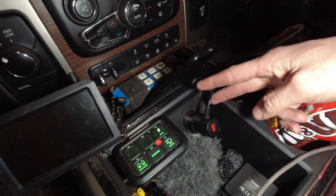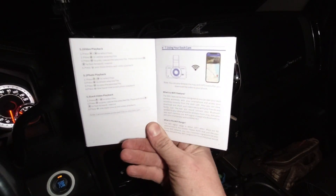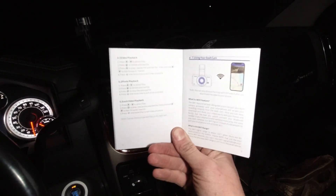What I'm going to do is get another power port and wire it up down under the dash so it's tucked away and you never even know anything is there. I just cheated and ran it to the existing port for now because it was getting close to dinner time and I wanted to make sure I had dinner with the family. If you're thinking just cut the wire and run it positive and negative — I tried that before with another dash cam and turns out that plug is a voltage converter that steps down the voltage to whatever the camera runs on, and then it doesn't work. So I ruined a camera doing that and I'm not going to do it again. I'll just wire in a power plug. Another nice thing about this camera is it Wi-Fis to your phone so you can watch the footage, save footage to your phone, instead of trying to watch it back on that little screen. Overall, very happy with the camera — it came with way more than I've ever seen come with a dash cam, and it seems to work.